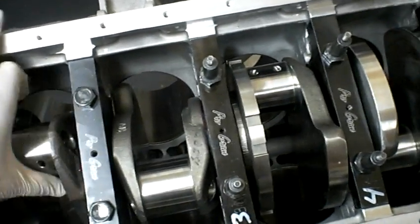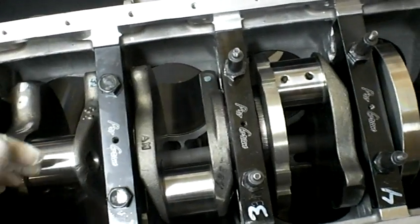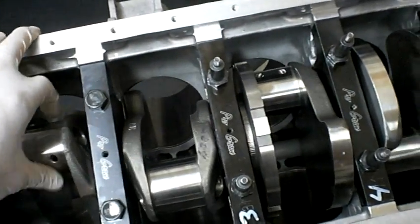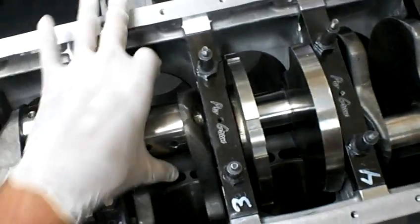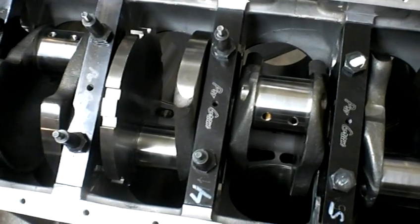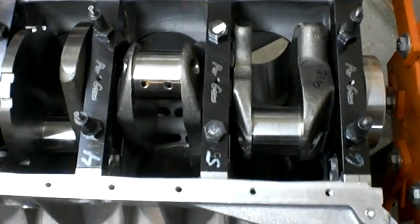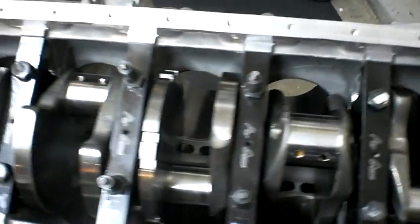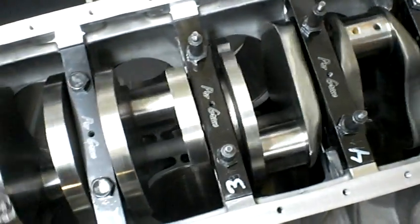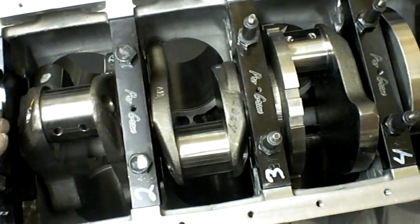My clearances were a little tight, so my crank was a little oversized. I wanted to go with a 1 thousandths under bearing, but I couldn't do that because Clevite doesn't make those anymore for the H-series bearings. So I basically went with 10 thousandths under bearings and had the crank ground down to match — 10 thousandths under on both the mains and the rods.